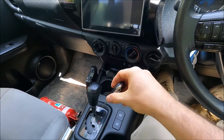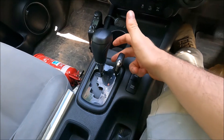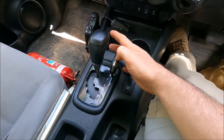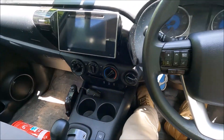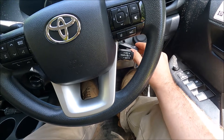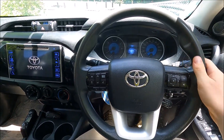To do that, use your Toyota key — flip out the actual key section like so, and push it into the slot just to the right of the shifter. A lot of them actually say 'shift lock' but Toyota don't seem to do that. Push the key down and that will allow you to move the shifter to the neutral position. If you are going to tow the car, also remember to have the key in the ignition and turn it at least one click to stop your steering lock coming on.